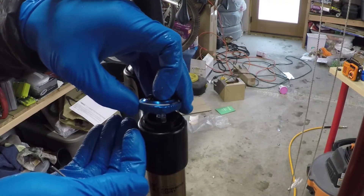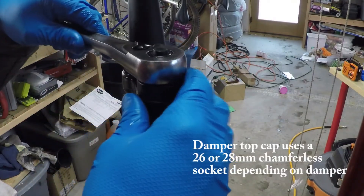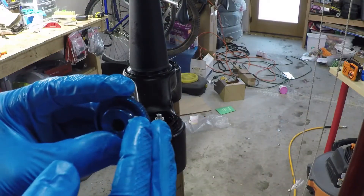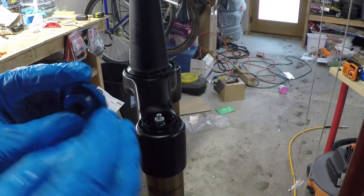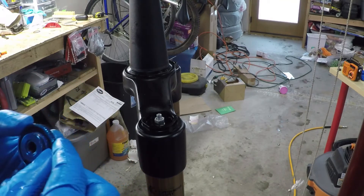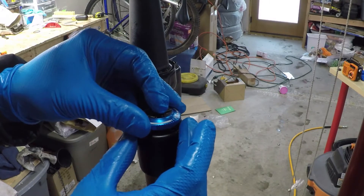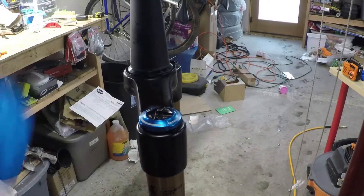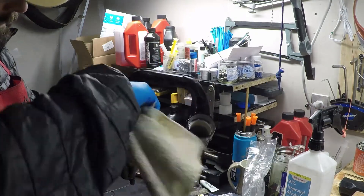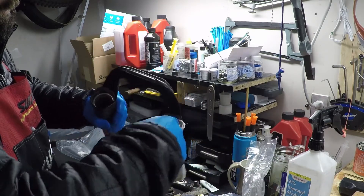When removing the damper top cap, make sure you don't lose any balls — everything on the damper side puts you at risk of losing a ball bearing, which is a detent. The reason I'm checking the torque of the top cap on the damper side is that the torque needs to be at a certain threshold to complete the pressing of the stanchion into the crown, which helps hold things together. Periodically check it — if you take your bike to a bike shop for a fork service, they will check it or at least they're supposed to. Loose top caps are common no matter who the fork maker is.